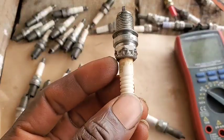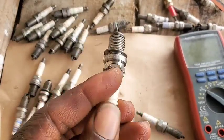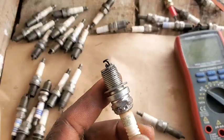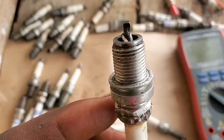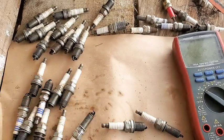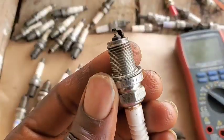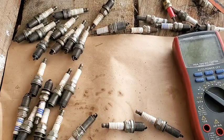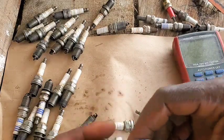This one has multiple problems. This brownish burnt residue you're seeing is a sign of blow-by, so it might be functional but the blow-by is going to cause some misfiring. Also, the ceramic has broken, which means the electrode will be leaking sparks — this spark plug is bad and needs replacement. The next one also shows blow-by and the iridium electrode tip is too short and should extend more.